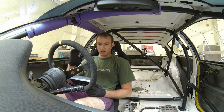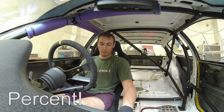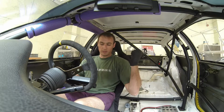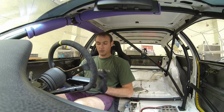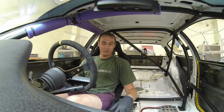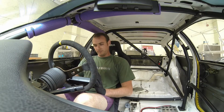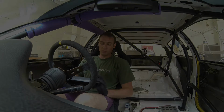So now we've got a split of, well, we have increased that by half a kilo. It was 30.4 before, wasn't it? So now we're 30.9, 34.4, 16.5 and 18.2. It was 3 a minute ago, but we'll stick with 2. And a total of 992 kilos. So where we've just lost 20 kilos, I don't know if that was a bit of a workout putting that wheel back on. I've lost 20 kilos, I don't know, but okay, we'll roll with that. So 2 turns on the coilovers has given me 0.7.